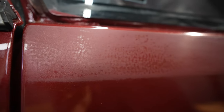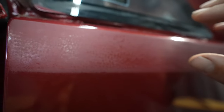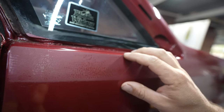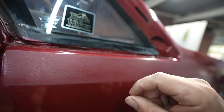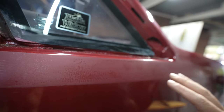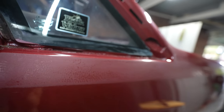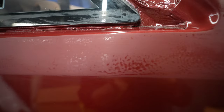Now, I painted this car myself. Don't try this on your car if you have no idea how much clear is on the paint. When I'm sanding, if I'm seeing red coming through on my sandpaper, then I know I'm sanding into the base coat. The way this paint system works is: you put down the color, then on top of the color there's more color, and then on top of that there's clear. I'm sanding only the clear. If I go through to the base coat, I have to repaint this panel or re-clear that section. So I'm going to keep going until it's completely flat.